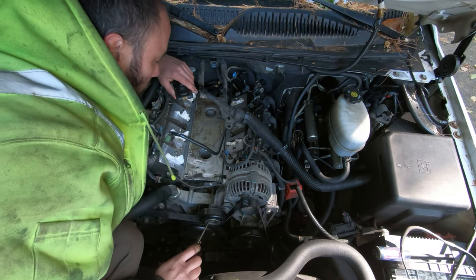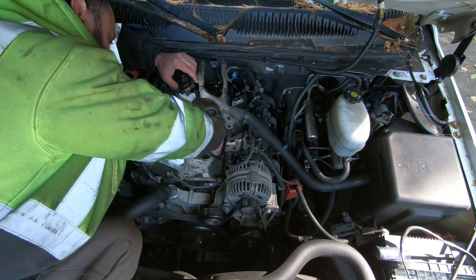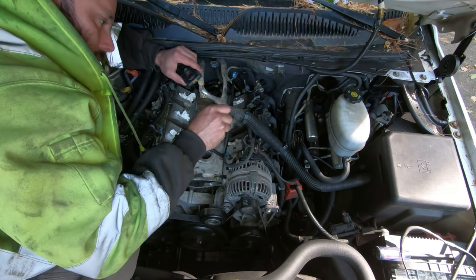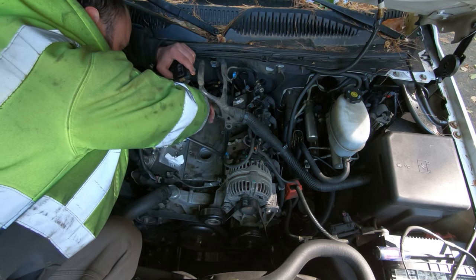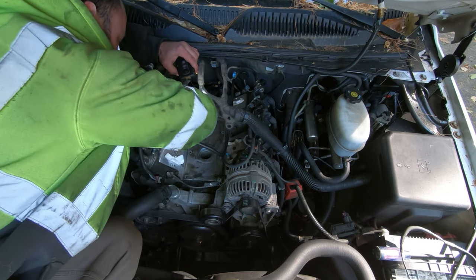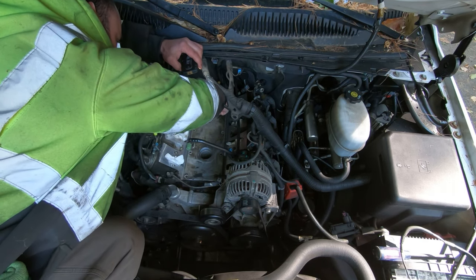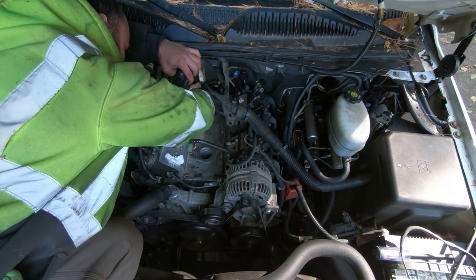I think these get hung up on those grommets in there pretty good. You've got to get the screwdriver in the hole, and then kind of hook it and try to pull sideways with it. I mean, don't get in the threads, but get a little bit of leverage. It's better than trying to wedge a screwdriver between the sealant surface.